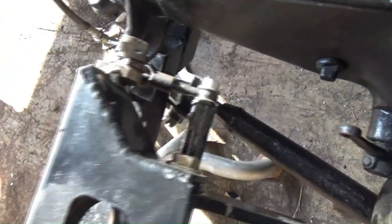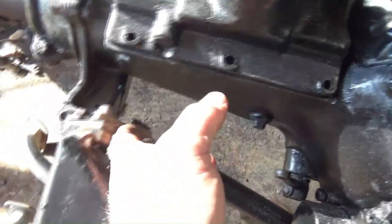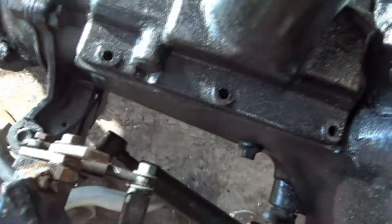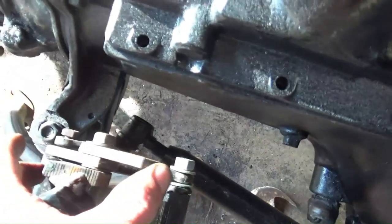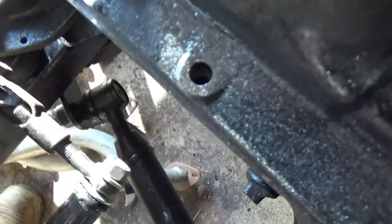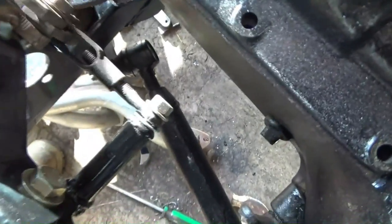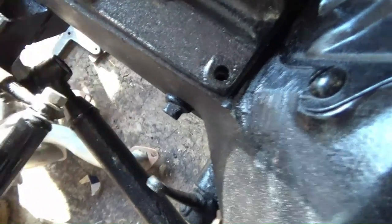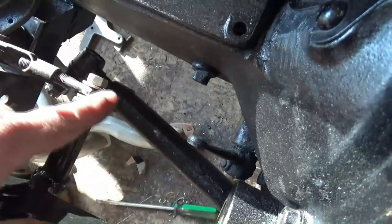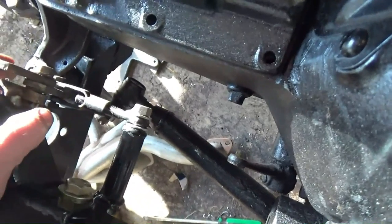Righto, let me show you what I've been working on. I've spent a lot of time thinking about this. I've welded on a bracket here that's threaded with a bolt. These two are independent at the moment — it was part of something else and I've just modified it. I'm keeping these two independent and I will weld them together once I get the right angle. When you look at the bottom shaft there, when I raise the pedal, I have a pedal there and this will then push — because it's pushing backwards that way — this will then push down to this guy here. So the next job is to make a rod to connect to that, and once I get the angle right where everything's going to work smoothly, I can adjust the length of this, then weld it in place and I'll have a working clutch. Fingers crossed.